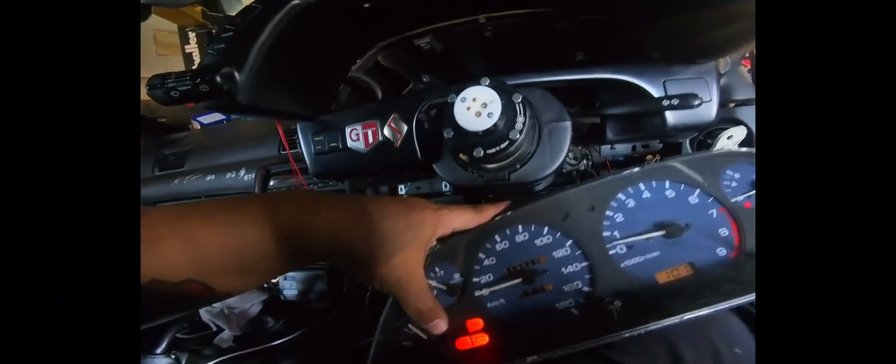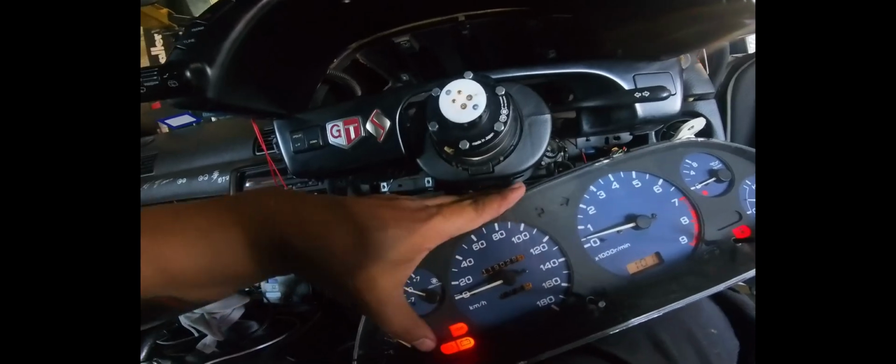All right, so we got turn signals, we got high beam, we've got the e-brake light, and now we're going to try to find this alternator wiring. So we know it's not this trace, because it's shared with the brake light. So we just need to follow the opposing trace, which is this one. Charge. So this wire right here is the charge wire. With that being said, if I start it up, I think it actually delivers battery power. So as you can see, with it started up, it gets battery power. So that is the charge light there.